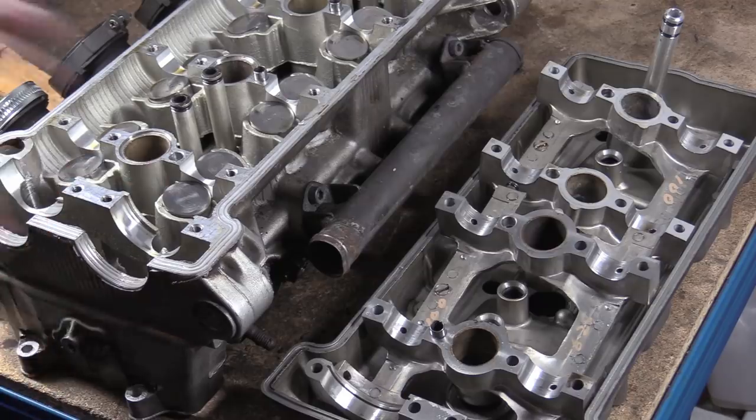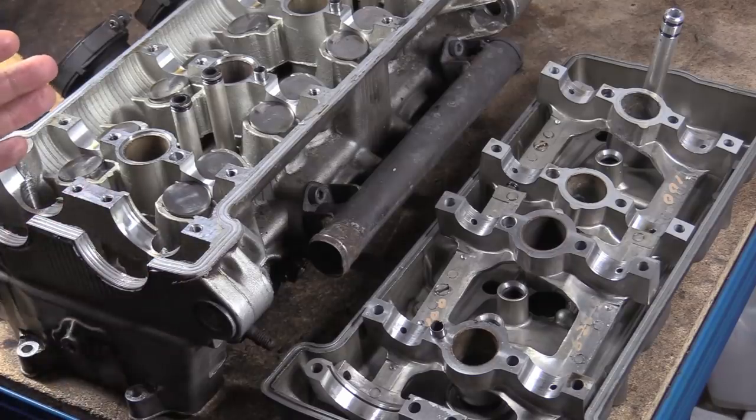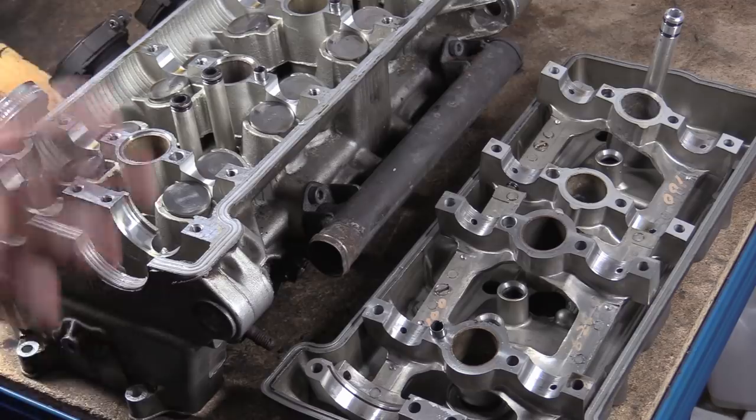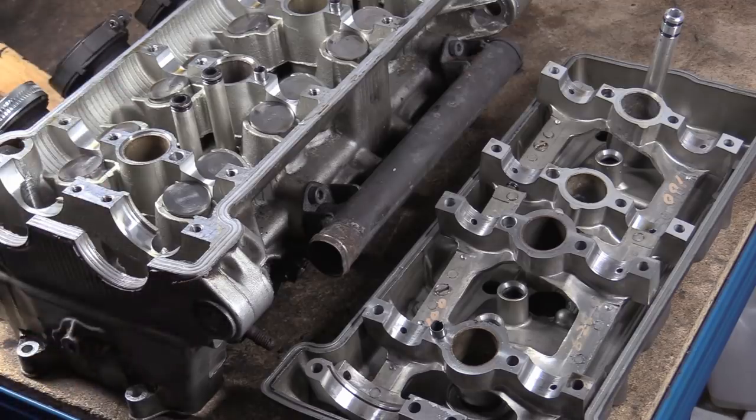Your camshafts would have to be new camshafts. We have removed material here, and trying to add that material back is just a massive pain. You could do some plasma welding or spray welding on the camshaft. You just don't want to do that. So ideally, if you wanted to bring this engine properly back to life, and we're only just looking at the head, we haven't looked at the rest of it,